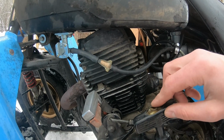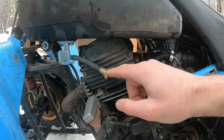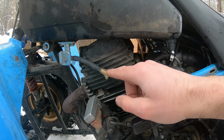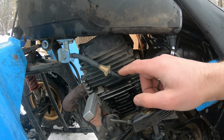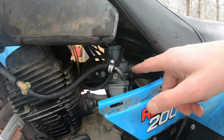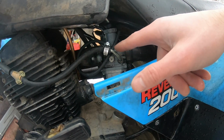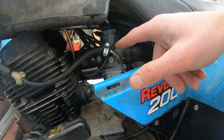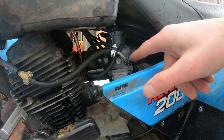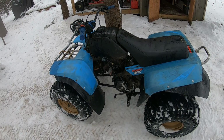And how I finally figured that out today is riding around and I was glancing down and I could see the air pocket in here, I could see the filter empty out. And I could ride it and I wasn't seeing it pulling fuel back. And I started to wonder. So I disassembled one more time, and this time I took brushes and pushed them through, and I took compressed air and I blew out the orifice. And once I did that, it's really running like a champ now.